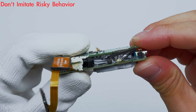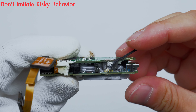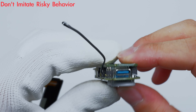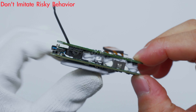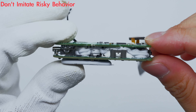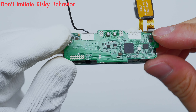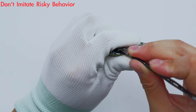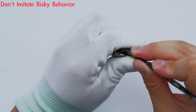The upper PCBA module is a wireless charging module welded with a wireless charging coil and an NTC thermistor. The bottom PCBA module enhances heat dissipation through potting compound. Filter capacitors and alloy inductors are arranged between the two layers of PCBA modules, and the modules are connected through connectors.